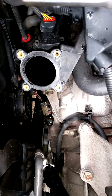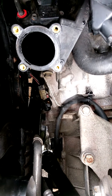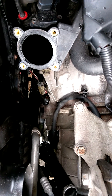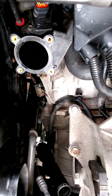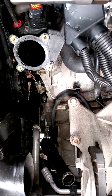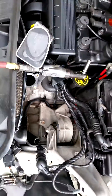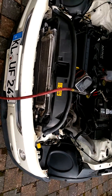You don't have to remove the front end or put it in service position, which will take you a few hours. This took me about 12 minutes to actually get the sensor out and probably about 20 minutes putting it back, trying to align that 10mm bolt. But other than that, it's not hard — it just takes a little bit of skill and finesse.